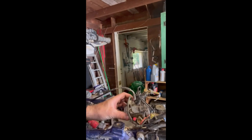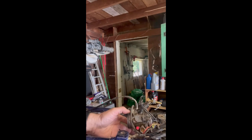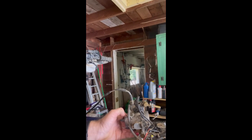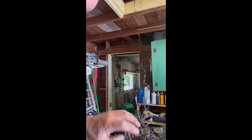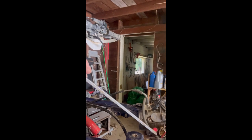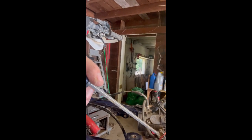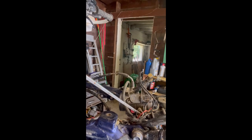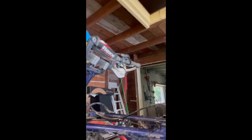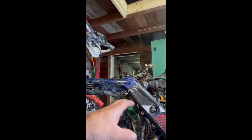This might help because I have one bike apart here. So this is your fuel injection and it sits like this. See, this is your injector here, and it's this fitting right here. It's got a flathead — you just put that in there. And like I said, that sits right down here below your fuel pump.